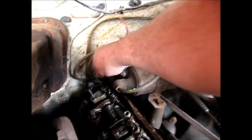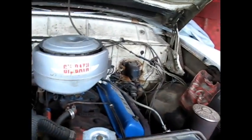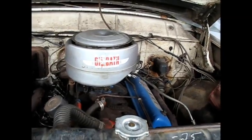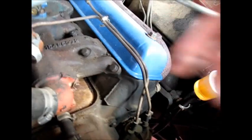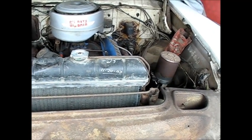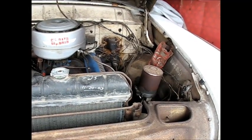I know exactly what the problem is. The big question is where did that rod go - it's down in the motor somewhere, that's not a good sign. I don't think I'm going to want to crank this until I solve that mystery. That means drain out the antifreeze, unbolt the manifold, this cover plate down here has got to come off. It'd be a good opportunity to clean things up too. We're going to pop off the carburetor - I've got a four-barrel intake that will fit this car that a YouTuber sent me, and also a two-barrel carburetor setup I thought about putting on here.